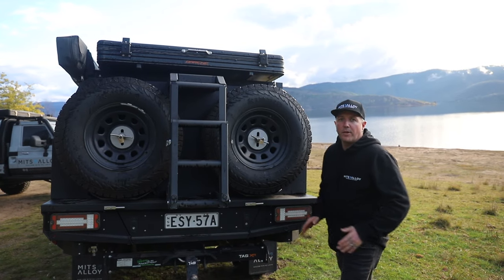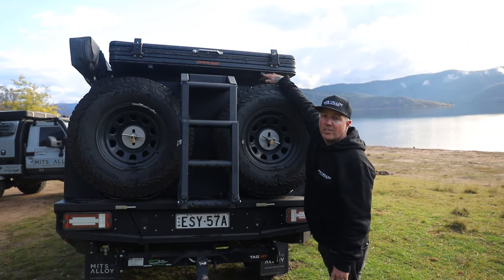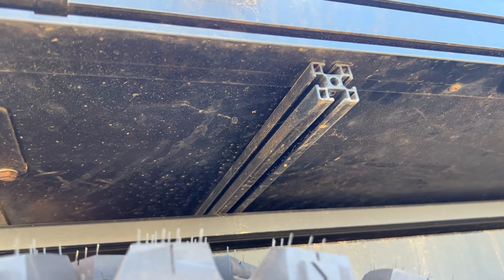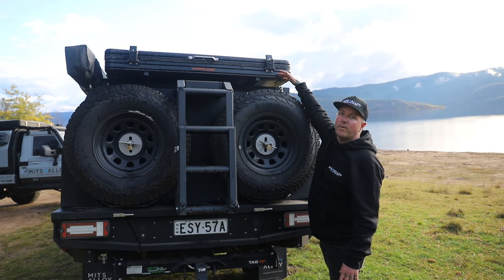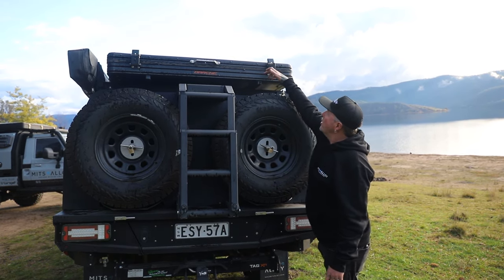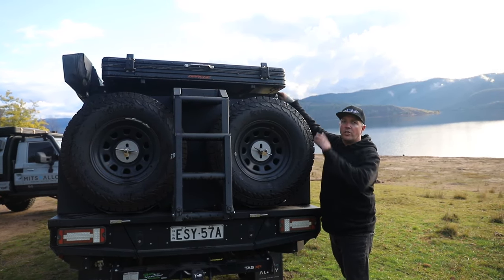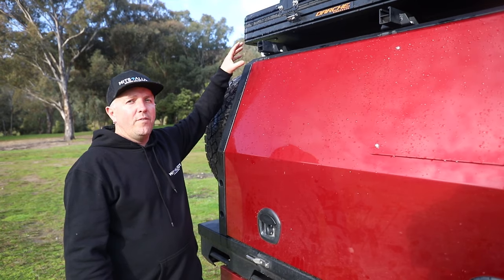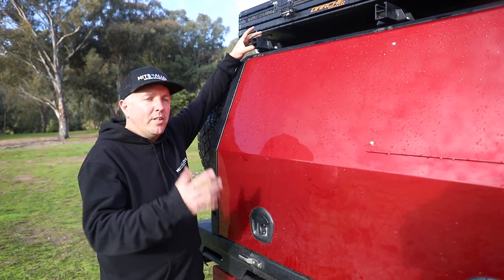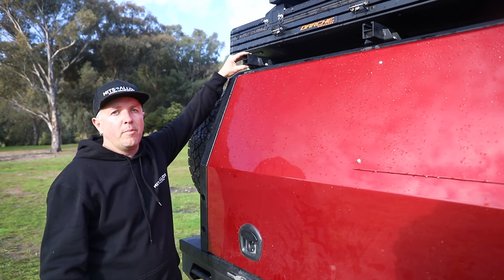So when it comes to mounting your rooftop tent, most rooftop tents do come with some sort of mounting option attached to it already. Like you see on the Darche one here, it's got this little extrusion. So it just makes it easier to mount. What we recommend is an easy bolt through system. So I'd recommend drilling directly through this extrusion. There is a strap that runs through there, and then using our MITS strut or uni strut in the full length roof rack and directly mounting it into a spring nut in our roof racks. If your rooftop tent comes with a U-bolt mounting option, we recommend using our multi-rack. It's just the safest and easiest way to mount that rooftop tent to the multi-rack.